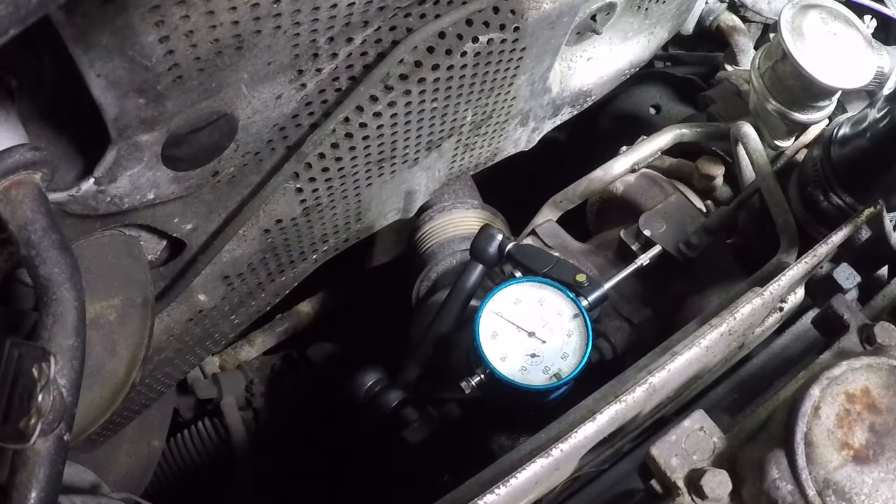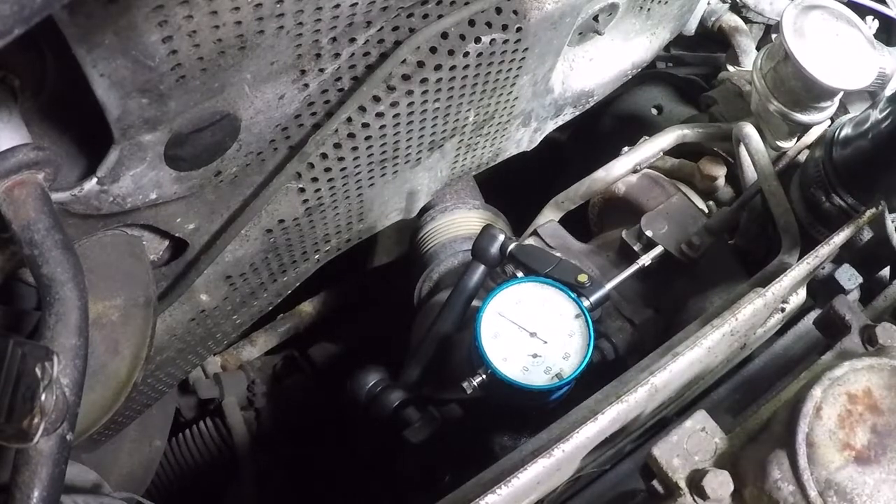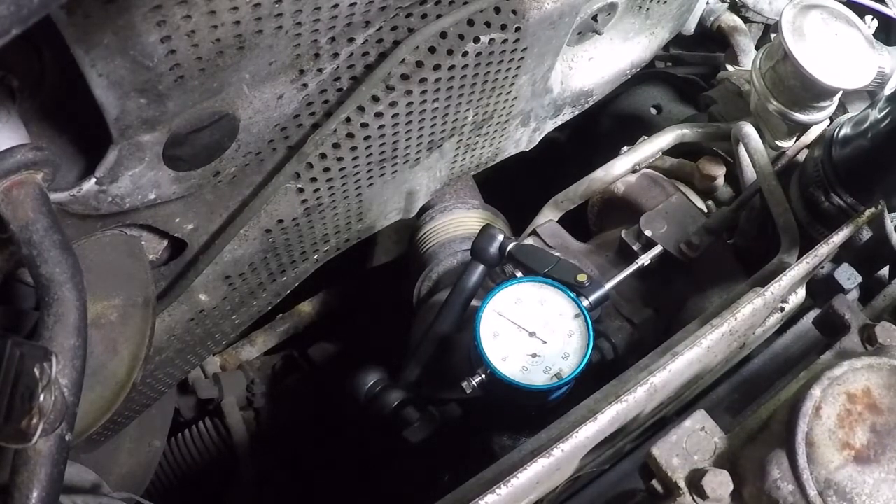Now there's a wastegate control over at the other side, which is a diaphragm and a spring, and it is what pushes the wastegate open under boost. It's pre-calibrated to open — in other words, push this rod this direction to open the exhaust port inside the turbo and dump some of that exhaust flow, which will in turn affect the turbo itself and basically cut the boost back. So it's a regulation system.